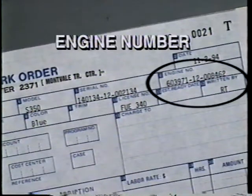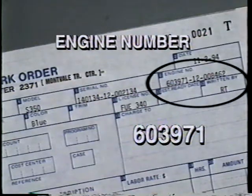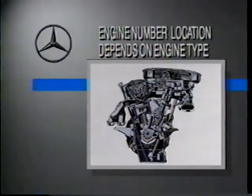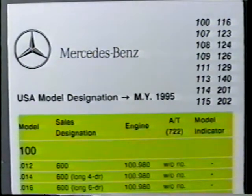The engine identification number is needed instead. The engine number is very similar to a model number. It has six digits, and the first three identify the engine family, while the second three identify the specific application. The complete engine identification number is stamped into all engines, but it can be a little difficult to see on some vehicles. Also, the engine number is found in different locations on different engine types, and in some cases the vehicle may have to be on a lift to see the number. There's a second pocket card that makes finding the number on the engine unnecessary. With this card, you can use the model designation, which is always easy to find, to determine the engine installed.